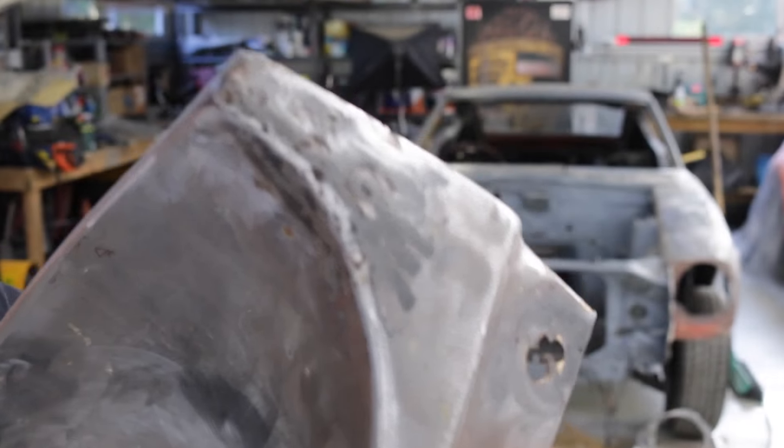With just a minute of basic panel beating experience, I've managed to get 80% of that dent out. I don't understand why people use so much filler when it honestly didn't take that much time. I've beaten this up as much as I can by hand. The next step is to get rid of these remaining dents, but because of all the framework underneath I can't get to it the old school way. The old way would be a slide hammer — drilling holes into the panel, then using a weight on a pole to pull the dents out, but you end up with holes all through your panel like swiss cheese. The new way is with a stud welder, which spot welds little pegs onto the car that you pull the dent out with, then knock the pegs off. I can't justify the $500 for a stud welder, so I'm going to attempt to make something similar.